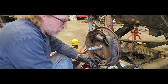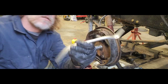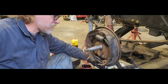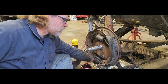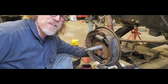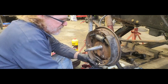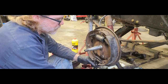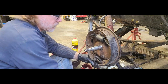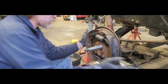Say you forget to do this part. It'll take a little while because it's kind of a tight fit back there, unless you get one of these guys as well, kind of like a little spoon thing there. It goes in that same spot. I don't know if you can see it. Yeah. It will help. You can adjust it from the outside there. You can do the same with a flathead screwdriver. Like I said, go ahead and get this guy adjusted about to where it was. All right, so that is fairly close for right now. Our shoes are riding where they're supposed to be.